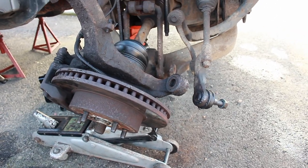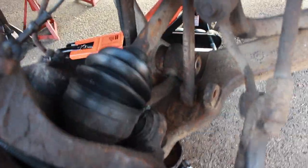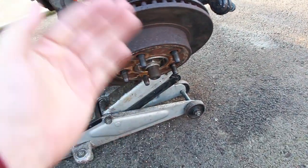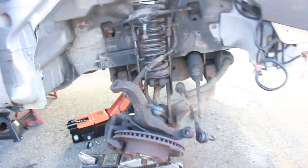It's actually a new day working on the Jeep. We spent hours yesterday trying to fit that spacer on top of the strut and we did manage it, however we can't get the bottom end of the strut with the drop links to fit back into the wishbone. Currently we have several bits detached: the track rod end is off, the sway bar link is off, and the two drop links are off. Our next plan is to take off the axle nut and try to bring the hub out, as it's just too far out for the drop links to fit. That's our last resort apart from taking the whole wishbone out and disconnecting the axle.